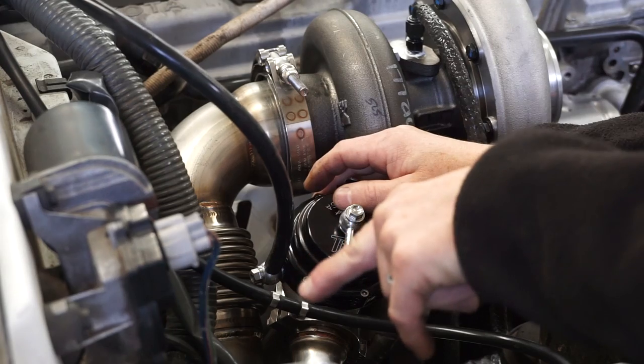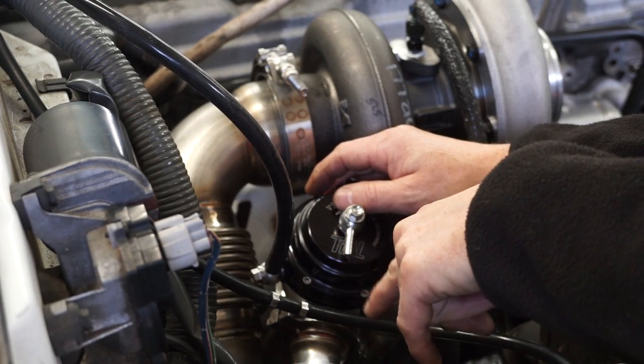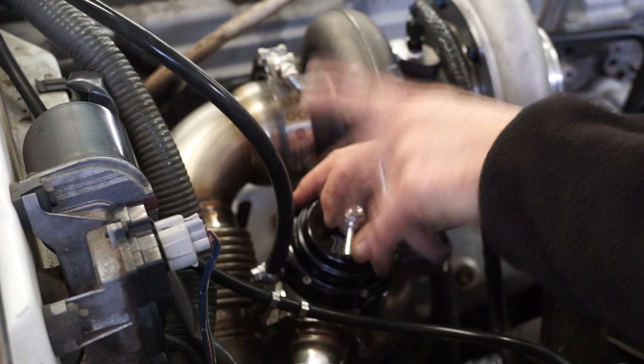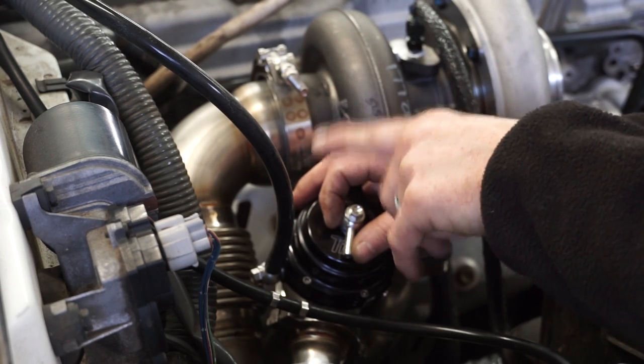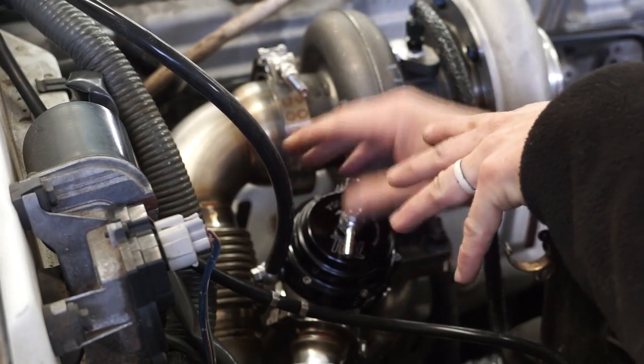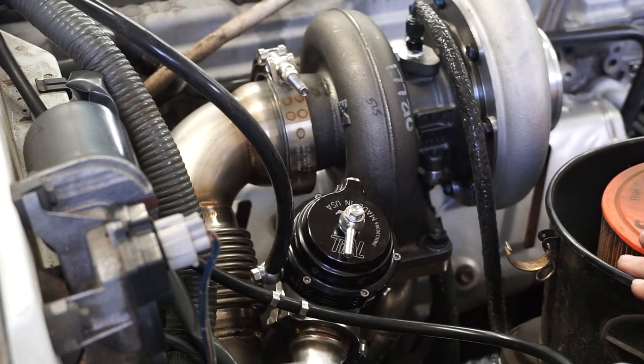So that's all in. I haven't done the clamp down underneath where the downpipe clamps to the original bell housing bracket. I will probably put you up in the air for that so we can see it better, because I can't get a good camera angle on it. And in the meantime, I also put the bottom half of the air cleaner back in.